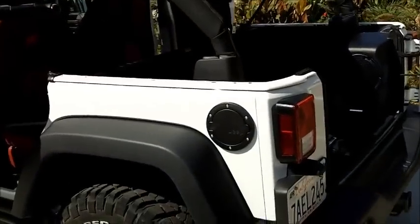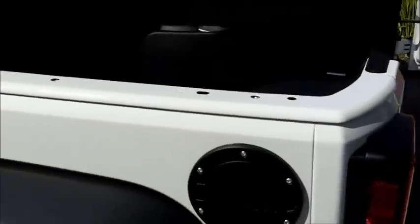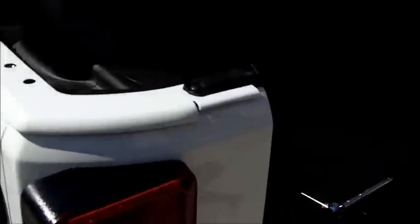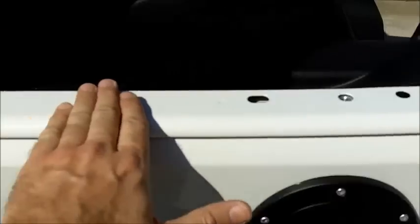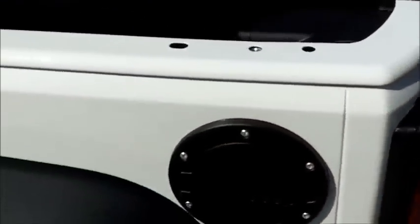Now that we've got the rear seat plate installed, we're going to start with installing the foam around the edges here. Most likely this is where the security lid sits on top, so you don't want to scratch and rub metal against metal. What you want to do is thoroughly prepare these sections here with alcohol prep, something to clean it down and remove any dust, debris, anything that's laying on there, so the adhesive gets a firm surface. So we're going to prep both these sides and install the foam layer.